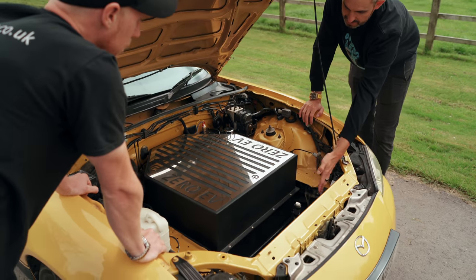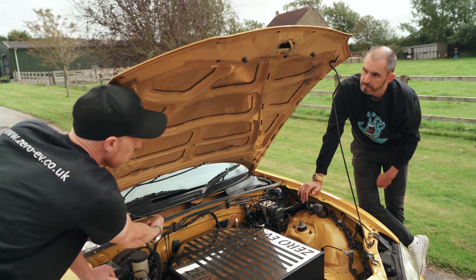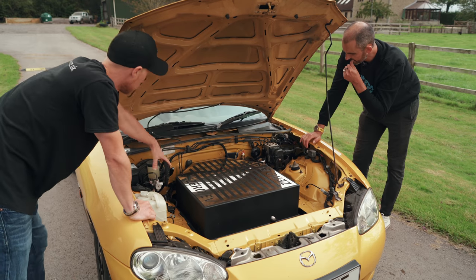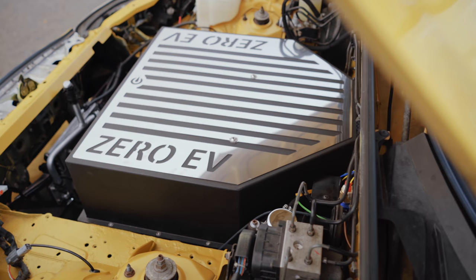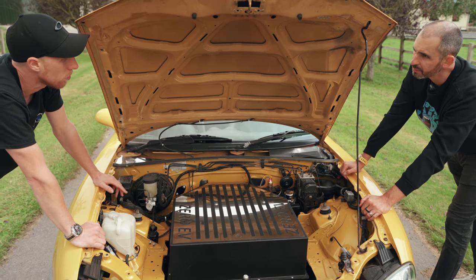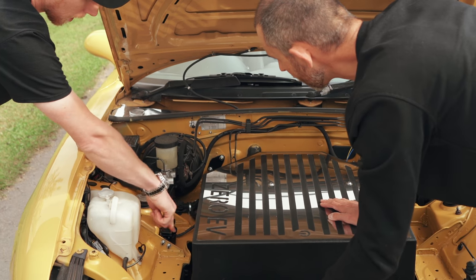There's scope to increase this if you ever wanted to. The big benefit is the gearbox and motor is in the tunnel, so this front area is batteries only, and the control system. Then we've got our vacuum assist system — so it's original braking, but we've got a vacuum assist unit to keep the brakes working. It's basically a little mini vacuum pump and a reservoir that just kicks in and out when the vacuum pressure drops, so it's not on all the time. And then the only other thing is our throttle cable that comes in here, with a throttle pot — just a cable pull.